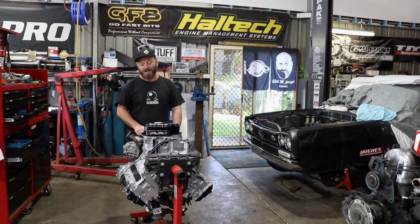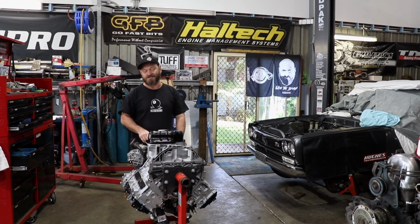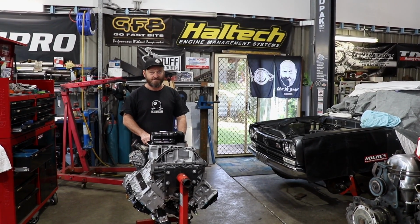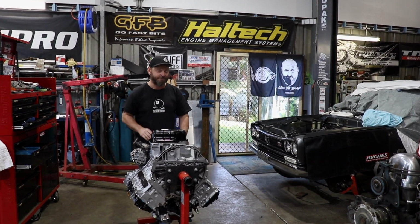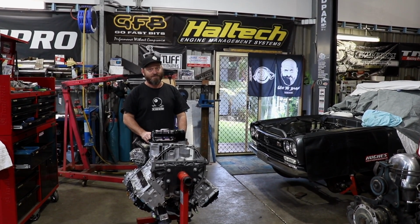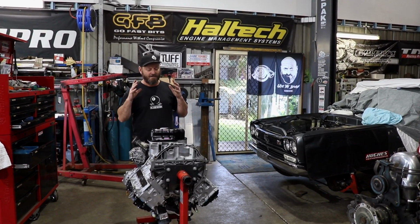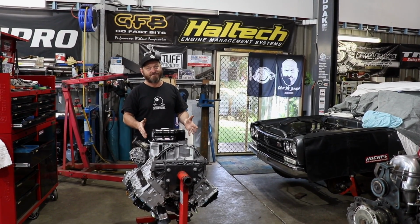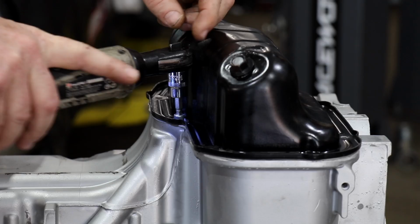We talked to Nelson from Hartley's Engine and Motorsport who built the engine, and he has another solution for us to fix our sump and steering issues. So today we're going to rip this old sump, the original Titan sump, off, and we're going to sling the engine in without a sump on it and the gearbox bolted onto it and sort of reassess it. And probably going to go for a front sump, which we're going to have to make. So we'll rip it off first, bolt the gearbox on, swing it back in and see what it looks like.